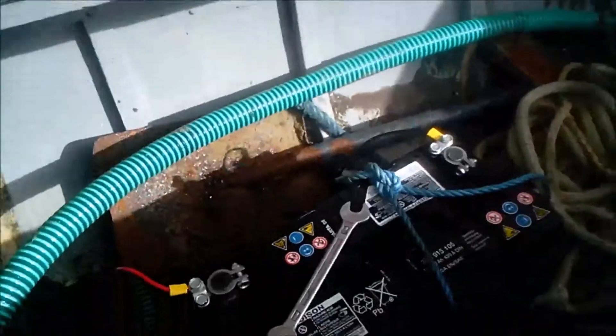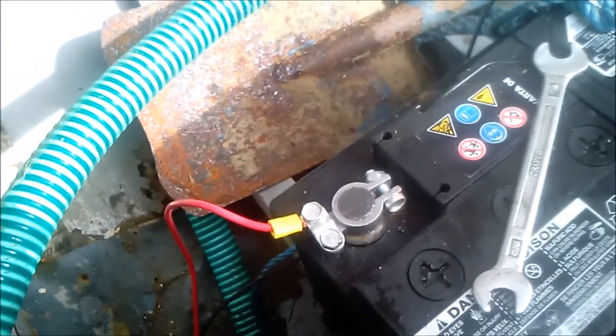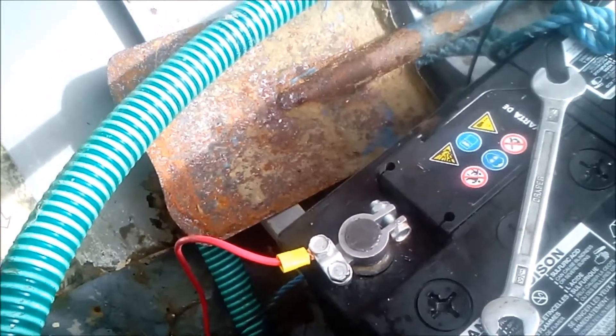I've done a lot of camera recordings but the battery was dead. What I've done today, like I said, is changed the wiring, pumped out the water, put some proper battery terminals in rather than those crappy little crocodile clips, and done some proper eye connectors for the wiring connectors.